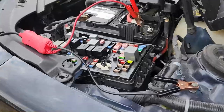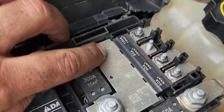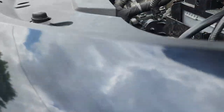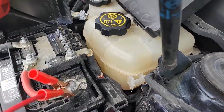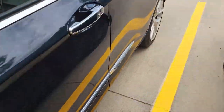The first thing I wanted to check — when a car has an accident and cables touch the chassis, that fuse blows. The fuse is right here and it says fuse number 4, which is actually 100 amp, not 80 amp. I checked it and it's good. It has 12 volts.